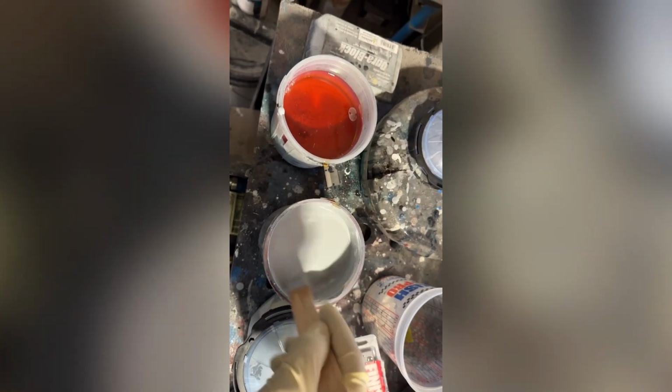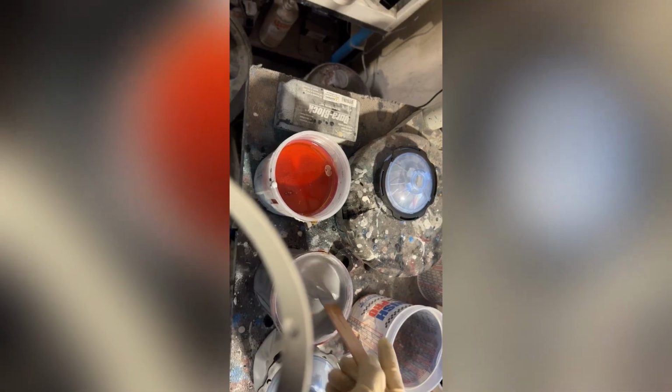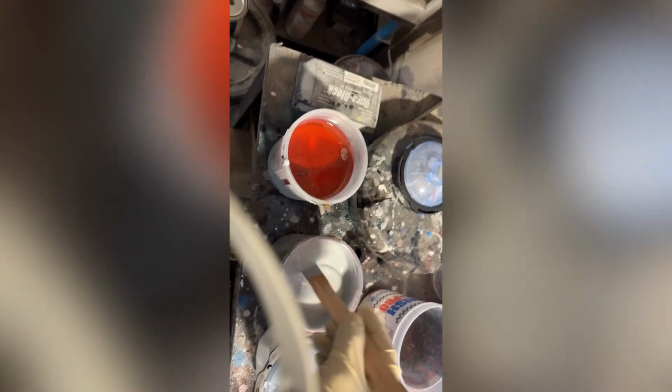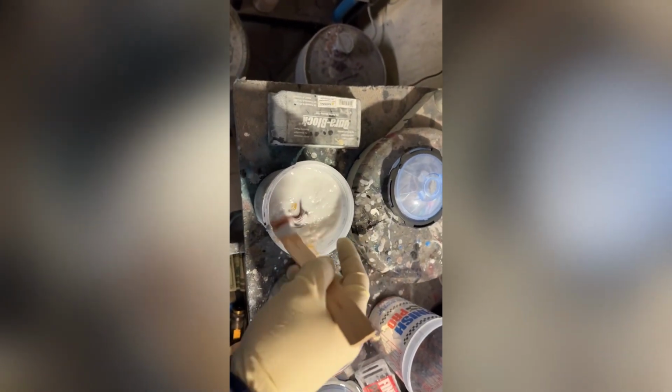Yeah. Mixing up my surface primer. I'm making 2 batches at the same time because I'm sure I'm gonna run out of a cup. This primer here, like I was mentioning, it's a really great primer. Highly recommend it. VP 2050 DTM, I believe, if I'm correct, has either a 42 or 72 hour window. Meaning, let's just say for example, you're doing a trunk space, you have Bondo, you did some corrections, you spray 2 coats of this. You could even thin it out just a little bit in that area. I wouldn't do it on the car. Come back the next day without sanding or anything. Come over with the sealer, follow with your base and clear coat, so it builds, acts as a sealer, protects the metal all at the same time. Look at the hardener, it looks like honey. Let's get this mixed up and then I'm going inside the booth.